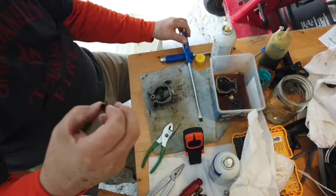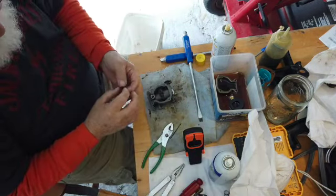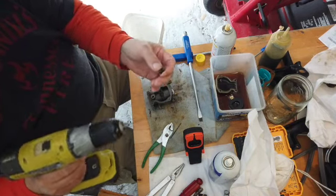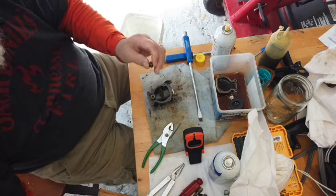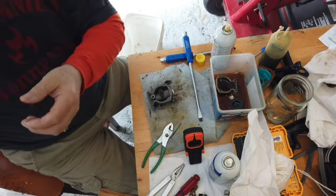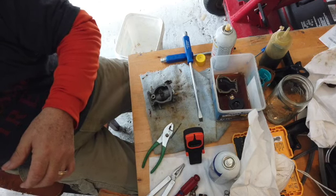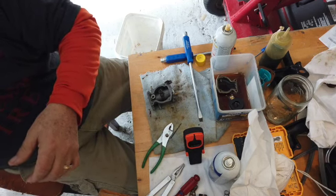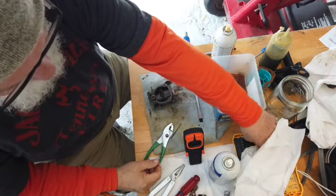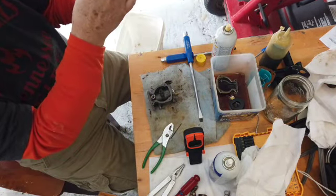See, this has a hole through it — you can probably see it too. There is a hole through the center of that, actually smaller than this drill bit. That hole must be open because gas needs to pass through it. Sometimes I can find a little piece of wire and push it through. Since it's such a small hole, I need something — oh, there's a little tiny drill bit.